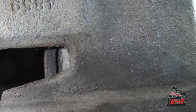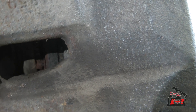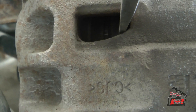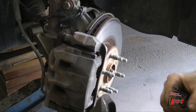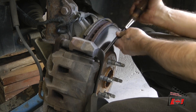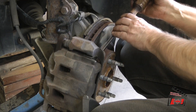The rotor is on the right of the shot and the brake pad is to the left of that. What I want to do is get my screwdriver between the rotor and the brake pad and just push them apart — that starts forcing the pistons back into the bore of the caliper. It's slow pressure, not fast. I've got it moving a little bit and I'm doing the same at the bottom hole. I'm actually slowly pushing the piston back — it's just the top piston so far.